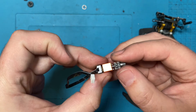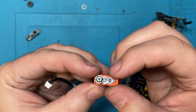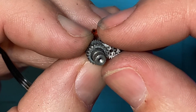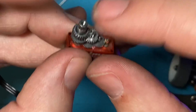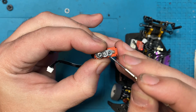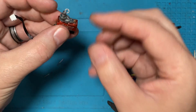You have to work it just a little bit because of the potentiometer - you want to make sure that key gets in there. Our gear moved a little, so we're going to pull it back out and move the gear a few teeth over and put it back in again, because we want that broken tooth to be as far away from where it's actually contacting on the gears. Ideally it's going to be exactly opposite of where it's contacting, but this is close enough.